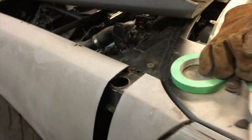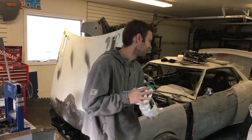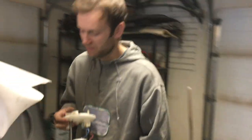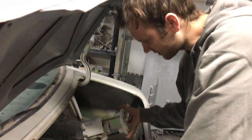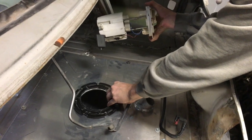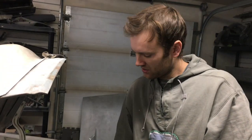Here is the fuel pump module that we're ready to put in. We cleaned out the tank — I'll show you guys that — cleaned up some of the edges, everything that's going to come off. We found that Permatex makes a silicone that's suitable for gas, so we're just going to put a little bit of silicone on the bolt threads. We're using this locking ring as the clamp to clamp this module down, so yeah it should all work good.